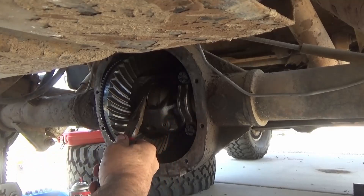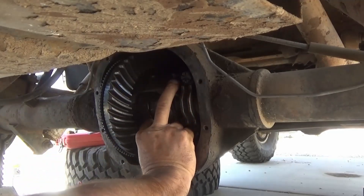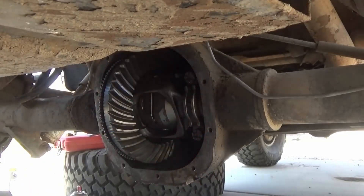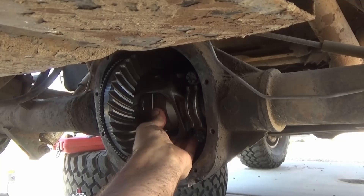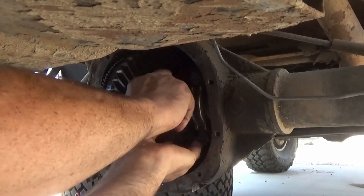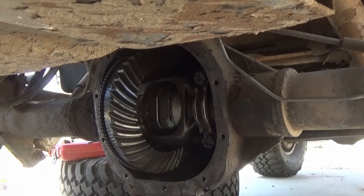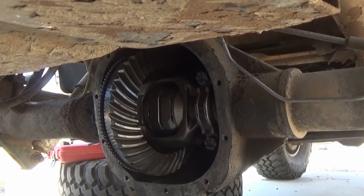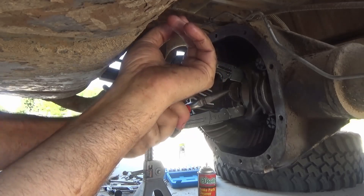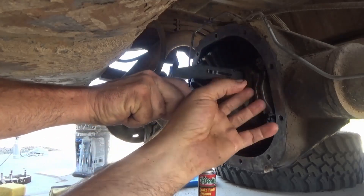You can see here that I'm pulling out all four of them. As you can see, the housing and the couplings on the inside can rotate freely from each other right now because there is no center pin to hold them together. Now that everything is rotated and snapped into place, you're going to rotate the center couplings around until you find a gap between the inner and the outer coupling. That gap is there to allow you to install the c-clip.